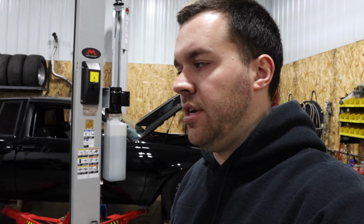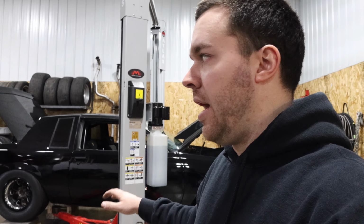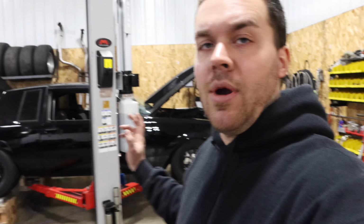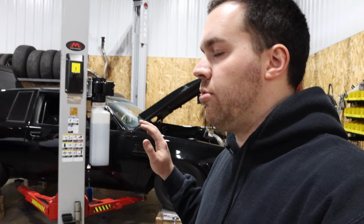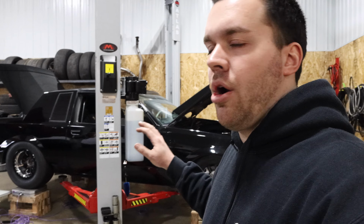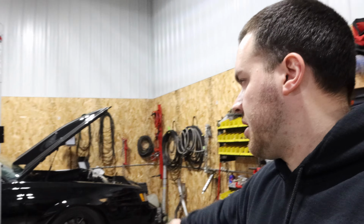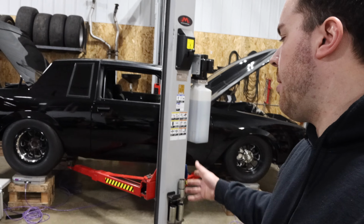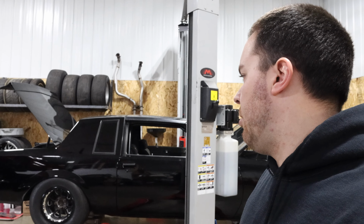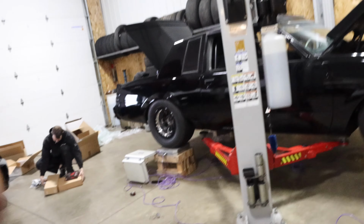And all we've done to it so far is we're just kind of going through it, nut and bolting the chassis underneath, making sure heim joints are straight and clean, corner balancing with the anti-roll bar in the back. It has coilovers in the front. The ride height is pretty square all the way around, so we're not really going to mess with that too much, which is good. We're just going to kind of clean some stuff. We are adjusting the anti-roll bar, making sure that the rear end is centered in the car, and then we are going to do our X measurements to make sure that it's going to drive straight down the road. Then probably it'll end up on an alignment rack at some point, but we just want to make sure that everything looks really close as it is. Otherwise, I think that's it.